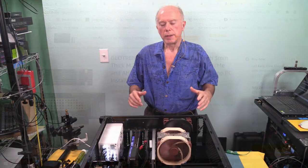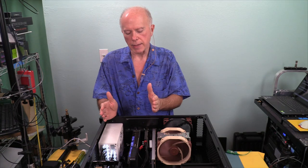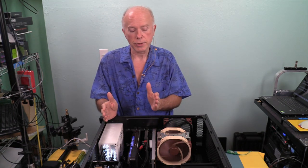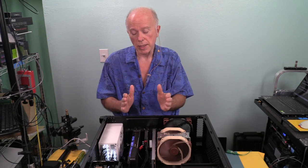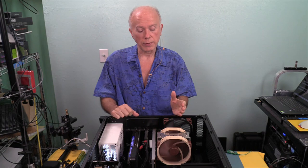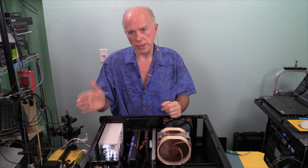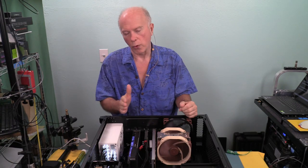And depending on your motherboard layout, we want to preface that, because a lot of times your 16-lane and 8-lane slots are slots that are going to the CPU. When you get down to the four-lane slots, a lot of times those may be a shared resource, and that resource may be going through the chipset. So with your performance, you have to look at: are we on the CPU or are we on the chipset? If we're on the chipset, you may or may not have PCI Express 4. We have to look at all that and figure out where your performance issues are.